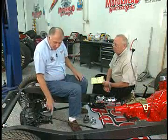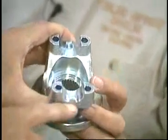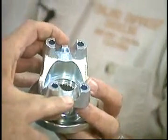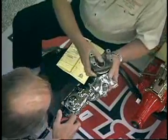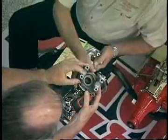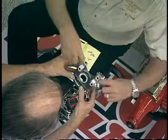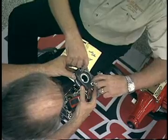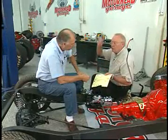Now, I noticed this has tabs, but not all yokes have tabs. Most vehicles will have this style of pinion yoke with tabs that center the U-joint — those little tabs right here. Those are on Ford rear ends and others. However, Chrysler and GM have their own corporate parts with no such tabs — it's just straight across. If you find one of those in your project, you measure in between the ears on the machined surface, and again you'll find the dimensions on the drawing. Check the box and give us a call.